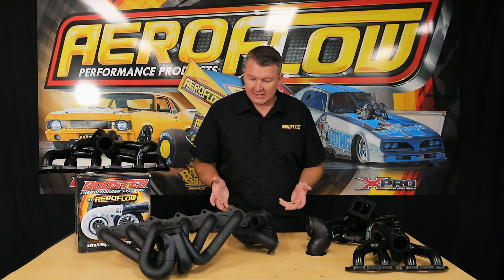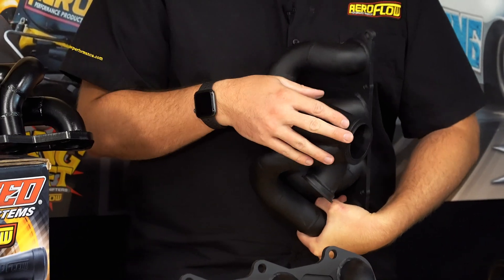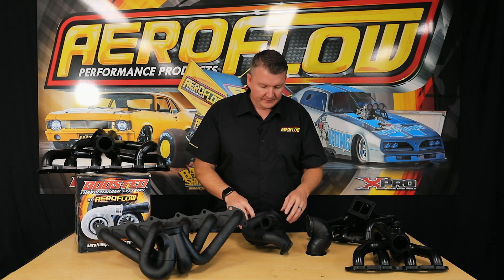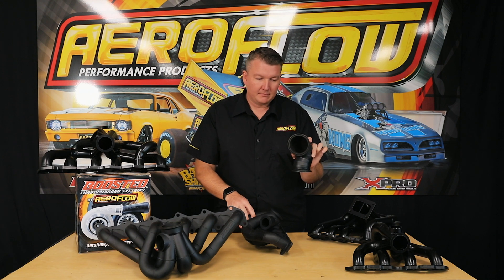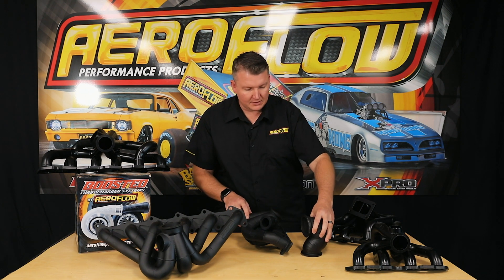There are a few different models here on display, as you can see. This one that I'm holding right in front of me is 4G63 — so for example EVO 4 through 9 — which will basically mount a G30 or G35 V-band. This is also available with a T3 flange, so plenty of options in T3 and V-band that will suit from a G25 or a Boosted 48-49, all the way through to a Boosted 68-62, which could also suit a G35 1050. Plenty of options within that to suit many different applications, whether it's circuit, street, or drag racing. We also have this nice little compact dump pipe that's designed to match our V-band exit on the turbochargers for the EVOs, so it tucks the exhaust down nice and tight in a very compact engine bay.